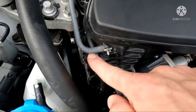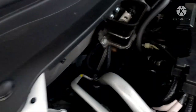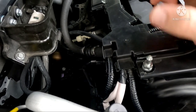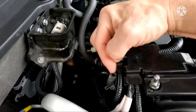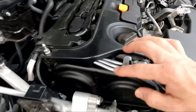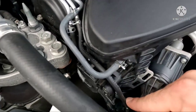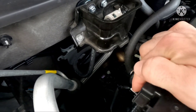That's your bypass valve. The hose runs up along here and as you follow it, it leads into this middle one. You'll have to unplug it from that check valve back there — the one I replaced in the previous video. Basically you're going to leave it unplugged and put the new line in place. Then pull the other tube that goes on the bypass valve — it doesn't matter if this stuff is open because you're bypassing it, it won't do any damage. You're going to plug the other line from the back side, and the bypass valve stays in place. Do not disconnect the wire harness — the wire harness has to remain in place.